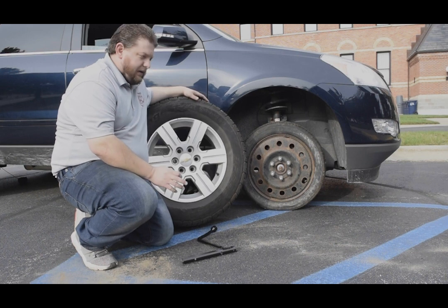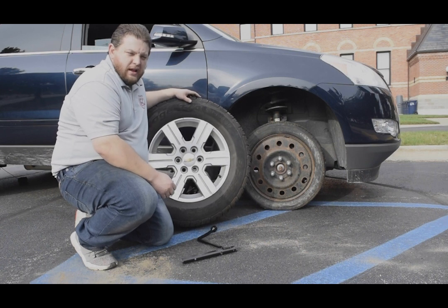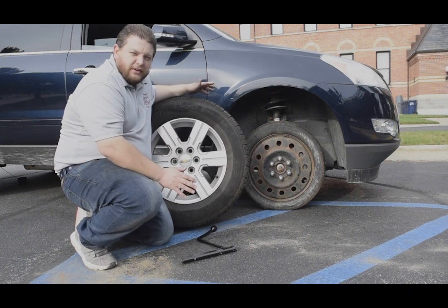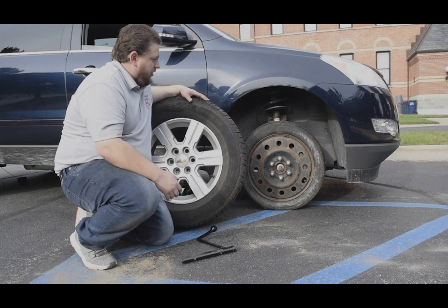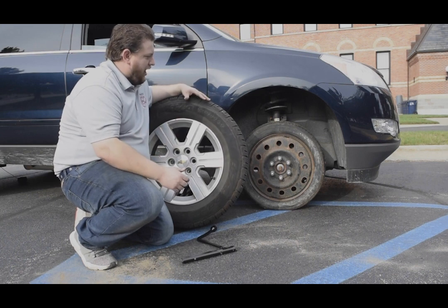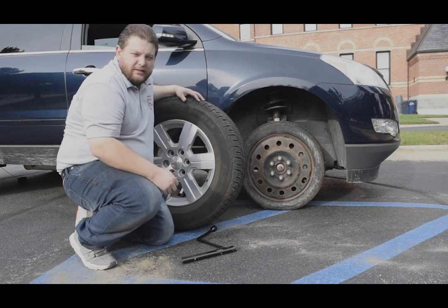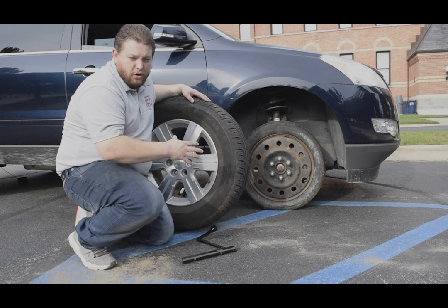With your spare tire, it is not a long-term solution. As you can see, there's a significant size difference in the tires. The manufacturer gave you that size because it'll work with this vehicle. It's ideal to not go over 50 miles an hour on your spare, and they recommend not over 50 miles in a single trip. The spare has tread on it so it can last a while, but you don't want it to get too hot because it's a smaller tire. Always run the air pressure on the spare at what it says on it — like that one says 60 PSI, which is significantly more than this tire, but it is a much smaller tire, so it needs that larger pressure to handle the weight of the vehicle.